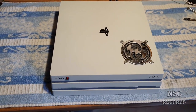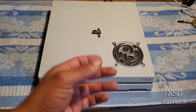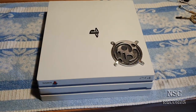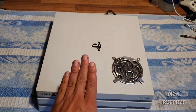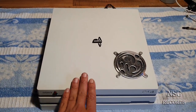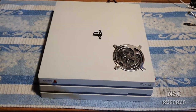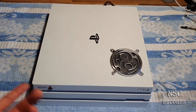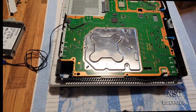Let's see the CPU, the copper heatsink and all the stuff. You should know that liquid metal with time will get hard, and it will be a little bit difficult to clean this from the copper heatsink. Like I told you, you should always apply this only on copper coolers or copper heatsinks. Do not apply liquid metal on aluminium. I'm going to open it and then we'll take a look inside. Let's go.